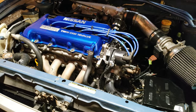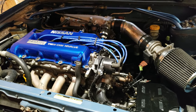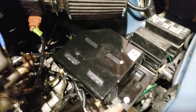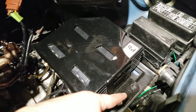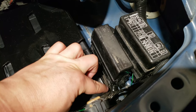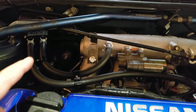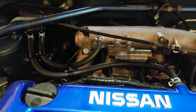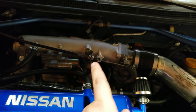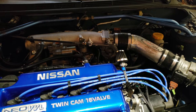Everything else is basically good to go. The power steering still has some leaks, which is unfortunate — the power steering system on these isn't great for not leaking. The battery is all mounted up, with one bolt on one side and two on the other since one side interferes with the body. I've got the fuse boxes mounted and put some EPT foam down so it doesn't wear into the wires. The catch can system is all in — a six-element catch can with three-eighths fuel line. The intake manifold was vapor honed to make it look new again.